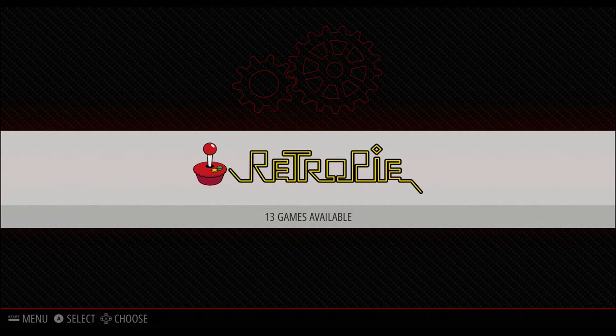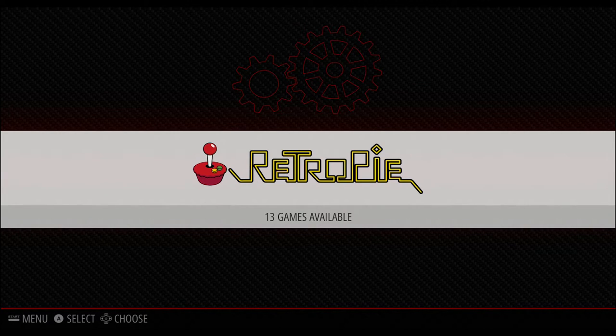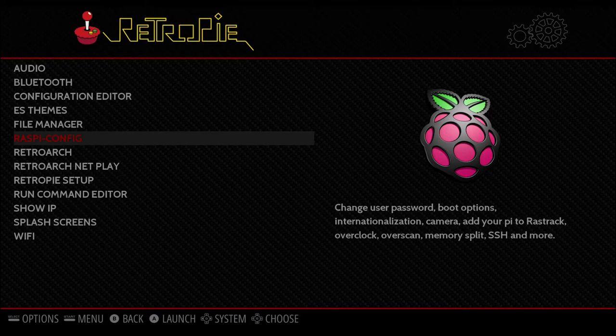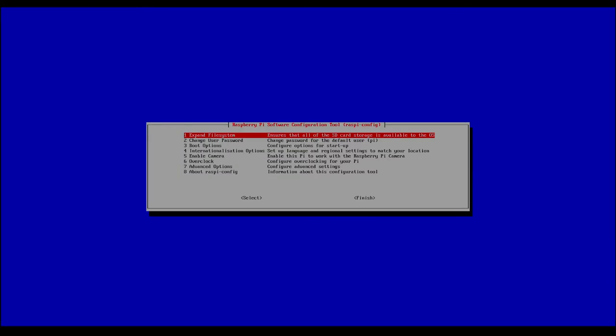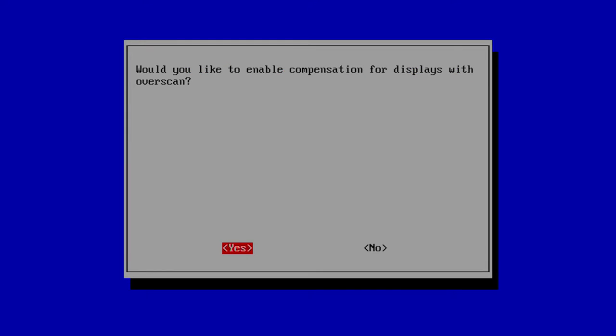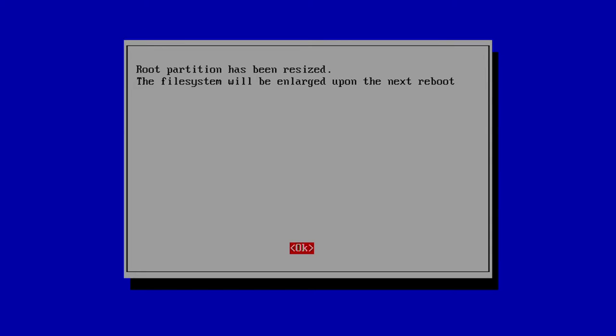When we first boot up, all we see is RetroPie — no emulators, no ROMs, nothing. We click A to launch the menu. The screen still isn't filling properly, so I'll go down to Raspberry Config to adjust Raspberry Pi features. I'll go to Advanced Options, then the Overscan section. Since we're using modern TVs, I'll click No to disable overscan compensation — you'd only want it for a CRT TV. I'll then click Expand File System to make sure it's using the maximum amount of the SD card.